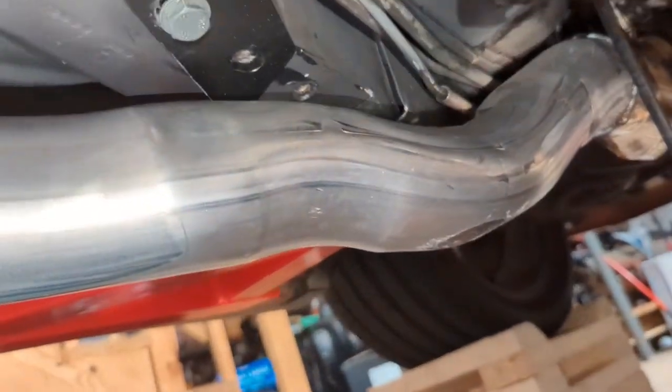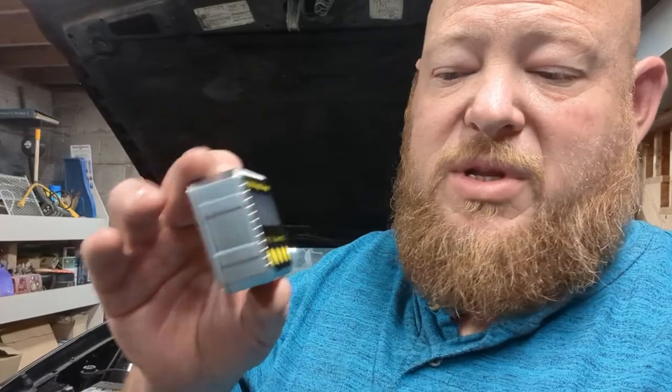Look at how much room we've got clearing the exhaust from the frame — it ain't touching, but it is close. It's tucked up so much tighter now. We may not drag as bad, but we still have to replace this exhaust. There's one more major thing to do: set the pinion angle. I got us a digital angle finder. When you're setting up the pinion angle, you're actually setting it to the centerline of the crank, not the output shaft. You put this on the crank bolt or the harmonic balancer.